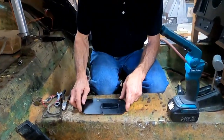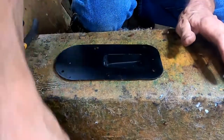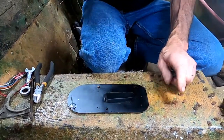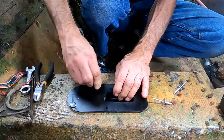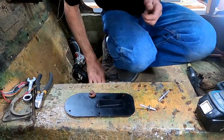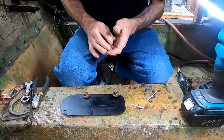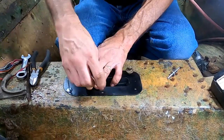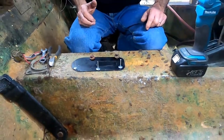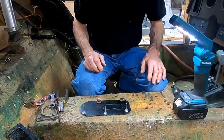Now at that point, test the fit. The way to really check to make sure you've got it in the right place: you can put the rivets in, but I would highly recommend putting the bolts back in first because the rivet holes may not quite line up with where they should be. We found differences in where the rivet holes are. Now both bolts are in — can you put all three rivets in? Yes, we can. Looks like we did a pretty good job on that one.